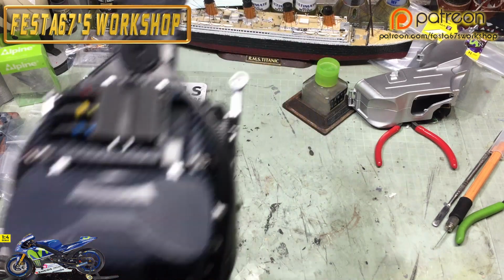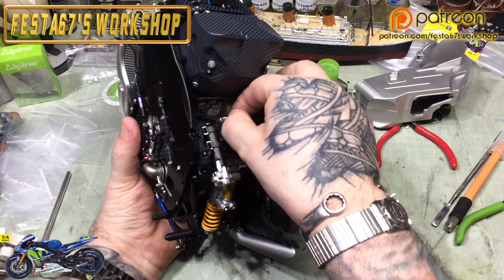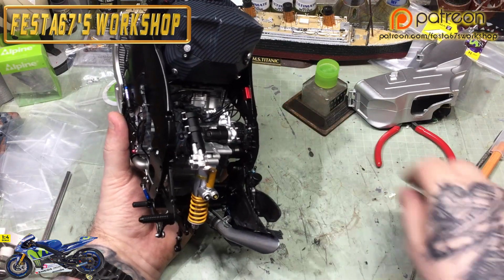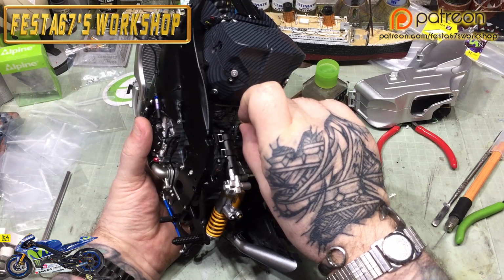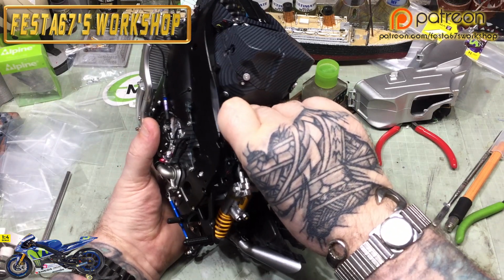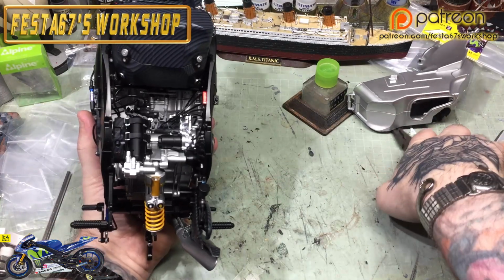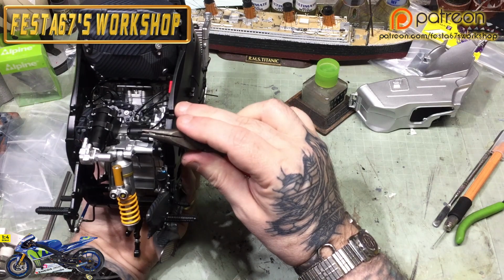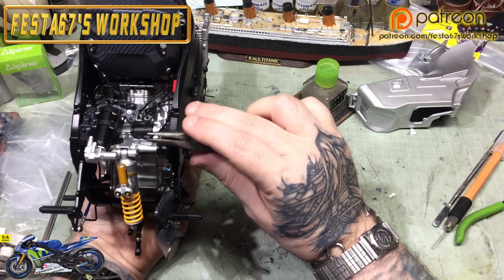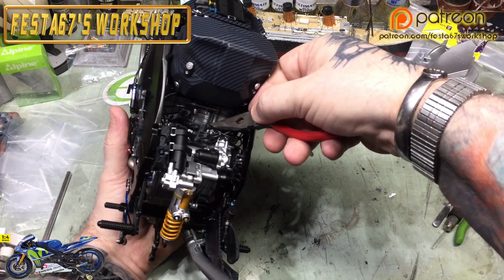And we can fit the brake control unit. Just quickly double check. And there's a couple of little holes just in the frame there where the clutch basket is. And it'll press fit in there. So we're more than happy with that now. Just push that pipe on now with a set of the old pliers.